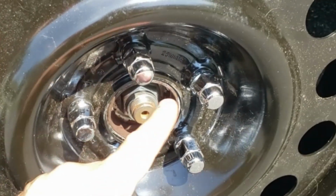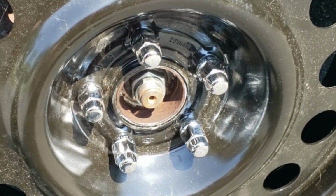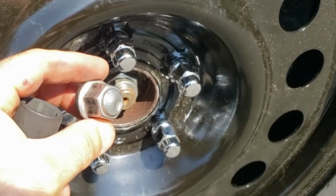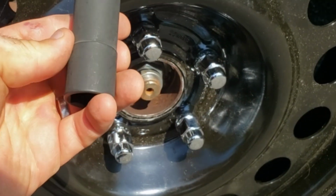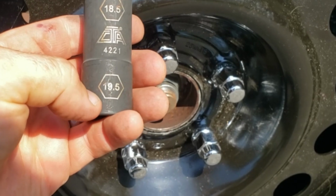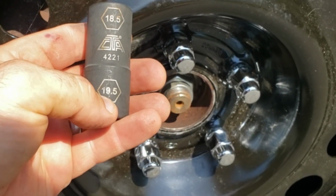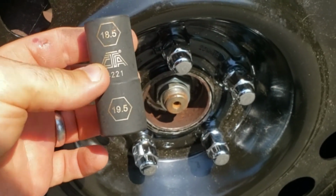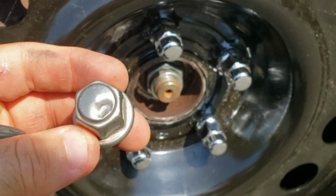So we have these single piece lug nuts on here by DP Accessories. They have a really hard outer chrome shell. They're excellent, and if you need to get off your factory lug nuts, I would recommend using this half-step flip socket. This is a flip socket by CTA, and it has a 19.5 millimeter size to get you just that half step above 19 millimeters, because if you go to 20 millimeters, you may strip it worse. I'll have the link for this in the description below if your lug nuts are starting to look chewed up and expanded like this one is.